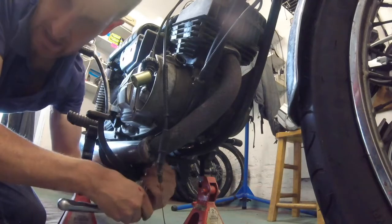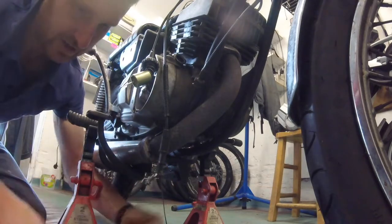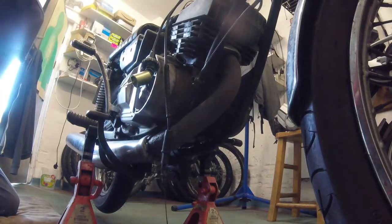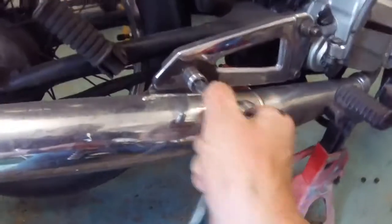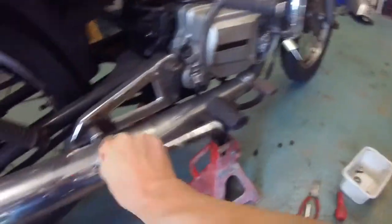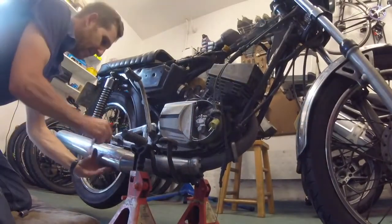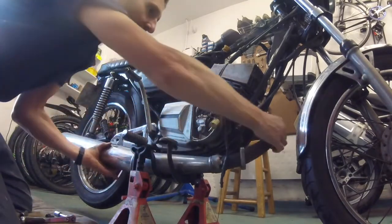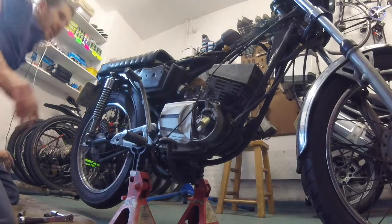Once you've undone that it's just going to come off. There it is — this is looking a lot more loose now. You'll find it a whole lot easier at that point to undo the exhaust, trying to undo it with one hand. Then you'll see the whole exhaust becomes loose. Just to save me dropping it and making a mess, let me put the GoPro down — there we go, off with the exhaust. That can just be threaded out nicely with a bit of a turn around, and you can see we're getting a lot more access now.